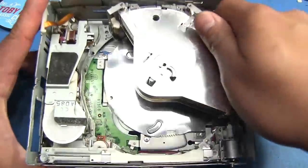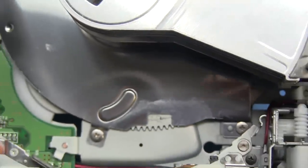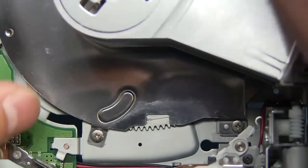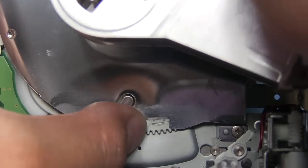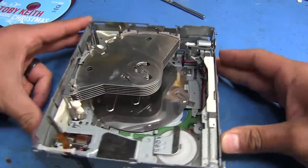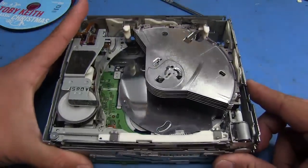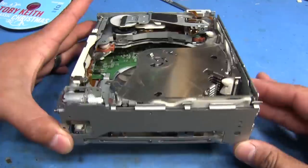That's it. Now I'm going to bring this back. Down here on the bottom you can see that really large gear — it says '2', which I'm not exactly sure what it means because that's obviously not the second disc. I don't have a service manual for this, so I'm just going by observations. I'm going to go counterclockwise and kind of help this along by putting a little force on this big gear here. I'm going to get to a point where it says 'S' — right there. That's the spot where this lowering and raising mechanism is able to freely move up and down. I think that's probably the reset position.